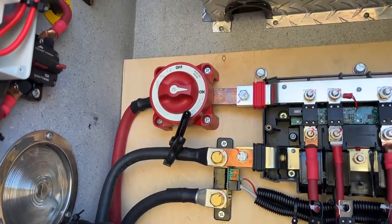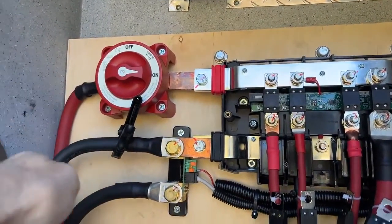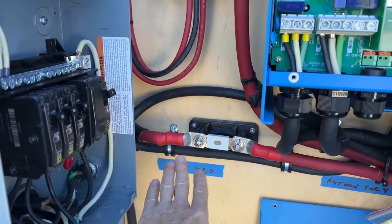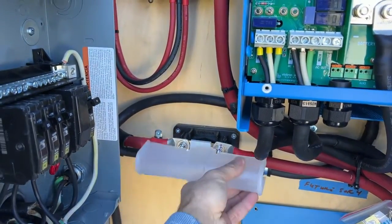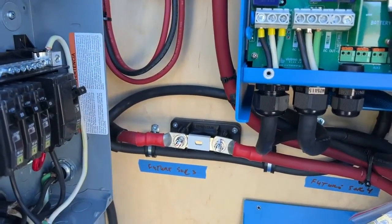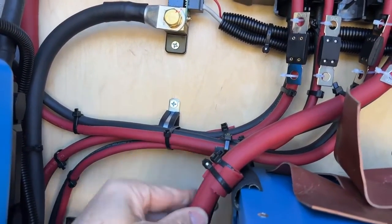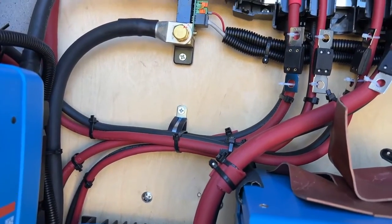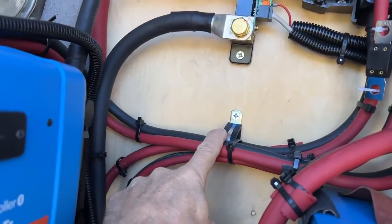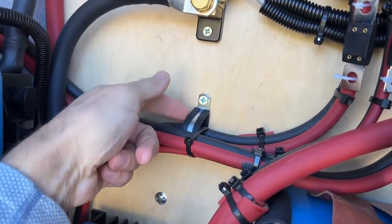Not to dismiss the top thing, which is a DC circuit breaker — a DC switch. This is running the bus over here and also going down all the way to the fuse. The fuse here is a little different than the fuses up top. I always keep this covered, using Velcro to keep that on. Throughout here I've used insulation to protect wires from chafing, and I use lots of tie wraps — very liberal with them — because we want flexibility so it can move with vibrations on the road. I also make sure connectors have a grommet built in, protected from vibration.